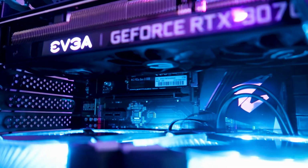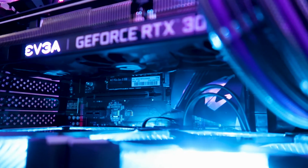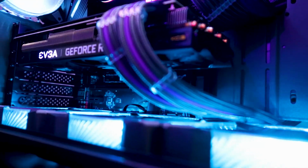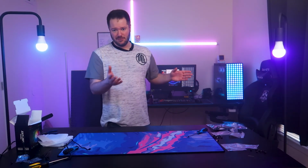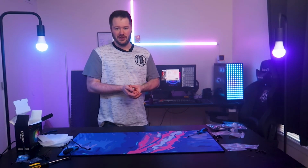It seems like it would be better with a micro ATX versus a full-size ATX in this case because of that reason. You can't get to that bottom PCIe slot. Nothing can plug into it. You definitely want to make sure you run your cabling, so your front panel connectors, your USB pins, and all that good stuff, before you ever install the fans, unless they're on the side of your motherboard, because it makes it near impossible to reach once they're done.